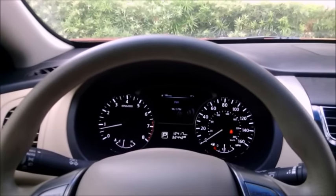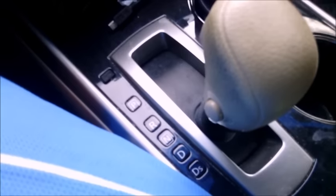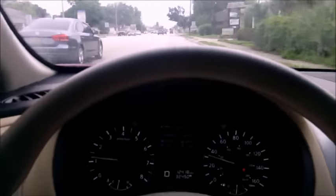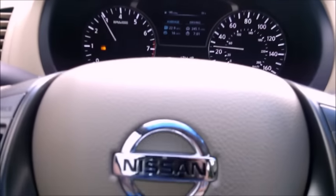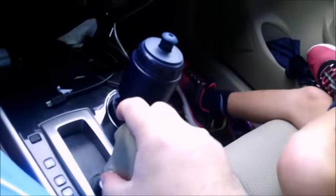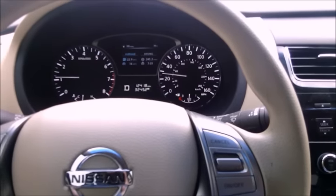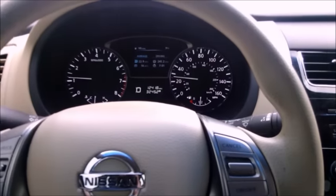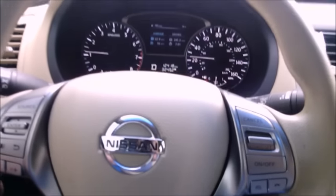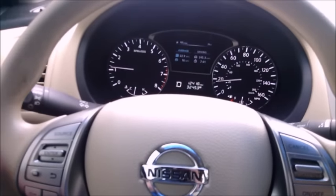I'm going to show you right now what it does while you're driving. We're going ahead and turning the overdrive off — as you can see we're driving on a road. If you can hear, my engine is going a lot harder. That's enough of that. You would normally use it like if you're going uphill at about 30 or 40 miles an hour and it keeps shifting from third to fourth gear repeatedly — that would be the only reason to turn it off, and to have more control.